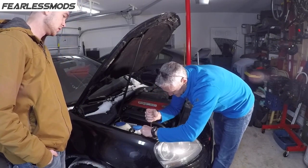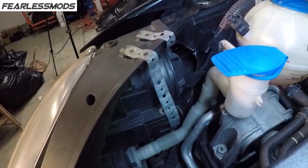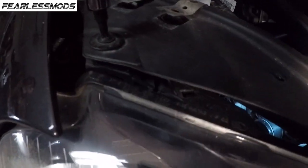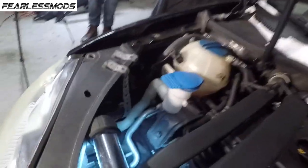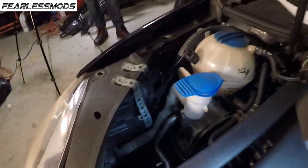Makeshift headlight holder — you served your purpose well. One of the things we did here to get us by was with this back tab in here, that piece of plastic in there is broken. That's the tab that holds the light level essentially. With that being broken, we had fabricated this plumber's tape around the back end, which served its purpose well. It stayed hidden under the hood when it was shut, but it's certainly a ghetto solution.